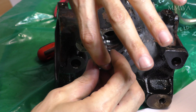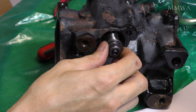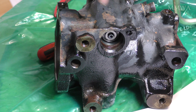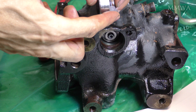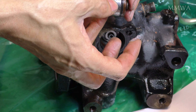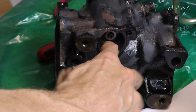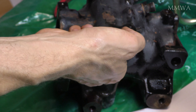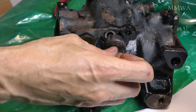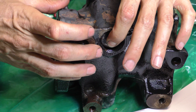This is just the new O-ring going on that cap. It's also mentioned in the manual that when you put that cap back on, there is a hole in the top and that has to be facing upwards. Here I'm just applying O-ring lubricant to the O-ring so it doesn't get shredded up as it goes back into the housing. You could probably use power steering fluid - that's probably what you should be using. The manual doesn't specifically mention putting anything on it, but I don't like the idea of putting a dry O-ring into a dry hole. I've had that problem before working on transmissions, so I learned from my mistakes.